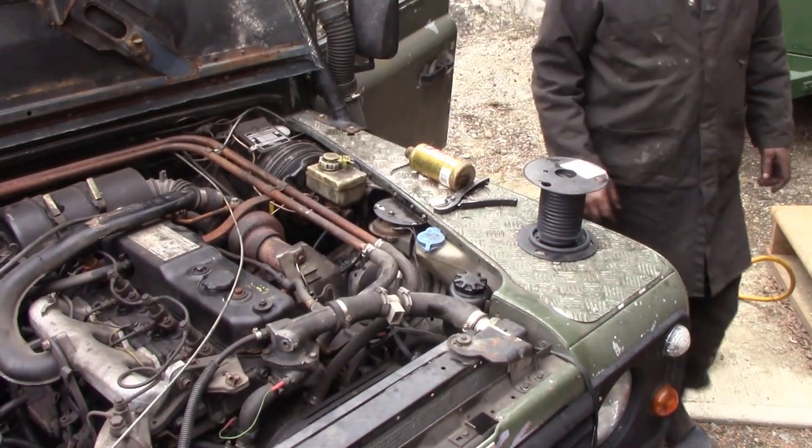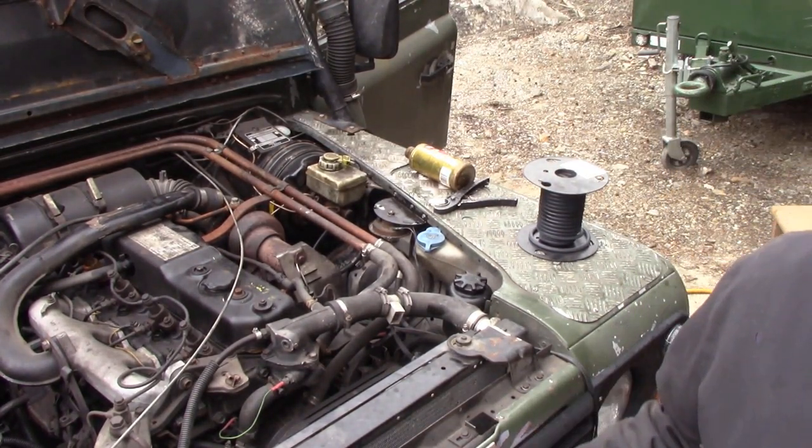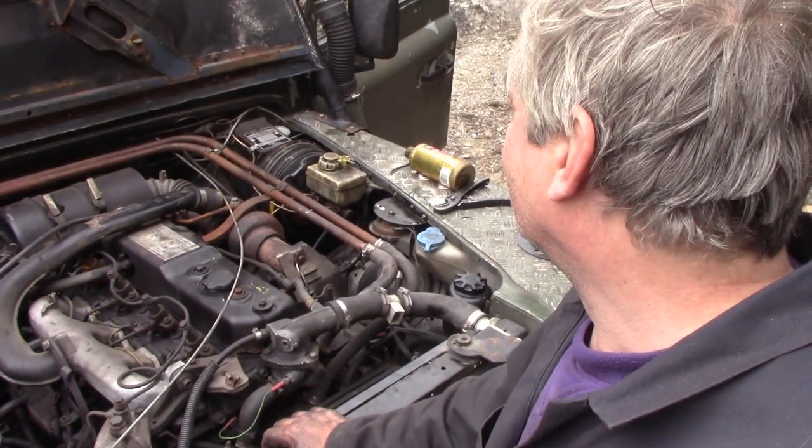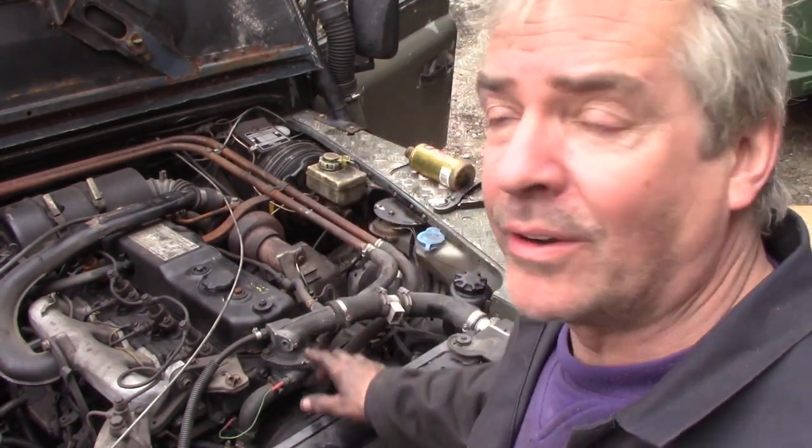It's a funny feeling. Oh yeah, I'm still on. It's a funny feeling that the pedal seems to have nothing, and then all of a sudden it's hard, like three-quarters of the way down. There's a bit of loose play, but I know that I can't adjust the pedal anymore. Now it's tempting to adjust the pedal, so there's something somewhere. There's no air in it, but I think the volume of fluid going to push that bigger bore is too much before it actually engages the clutch.